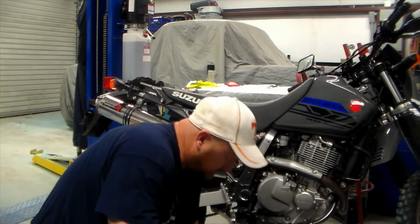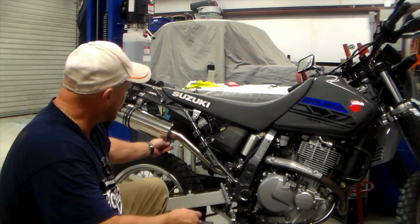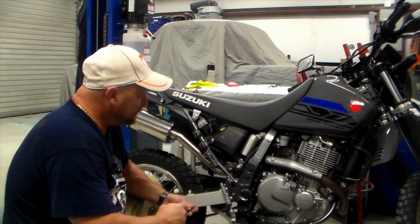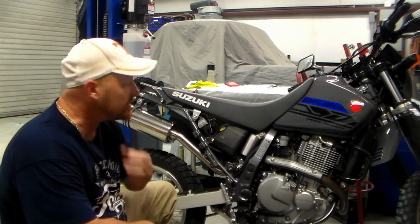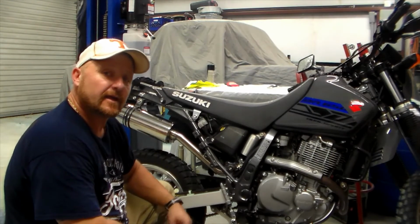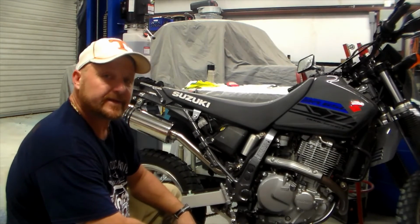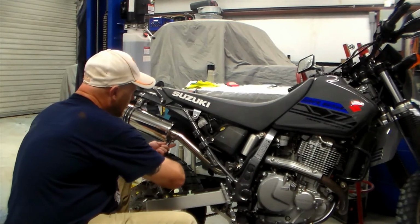So I will tell you, both of them went back on with a 6. Except this one right here, which came with the Dominator. This is your exhaust, your mid-pipe bracket. That's going to be a 5. So with the exception of the one that we had to Dremel tool and use a screwdriver and get creative with, this whole thing was changed out with a 4, 5, and 6 Torx head and a Phillips screwdriver to take the side cover off. Very simple, very easy to do.